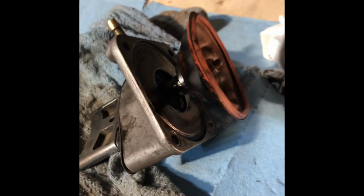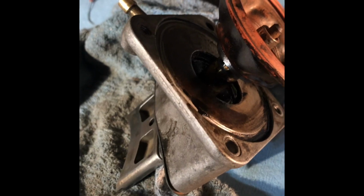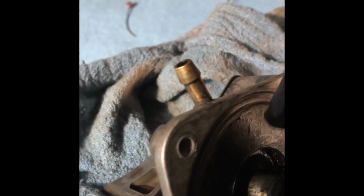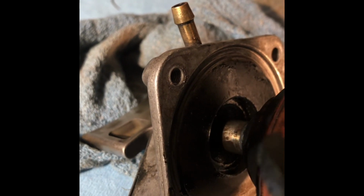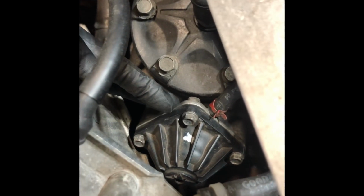We got them open now. You can kind of see there is some oil and some dirt in there. That's normal, but we're just gonna clean that all out. And way down in there, it's very hard to see, but way down in that collar are 2 little holes. And we're gonna take our little pin there and make sure we clean them out too. They're hard to see, especially now it's loaded in oil. I'll see once I get this cleaned up, maybe we can get in there and have a look. Oh, there you are. So that's one power valve, cleaned, serviced.